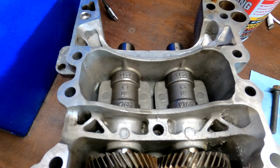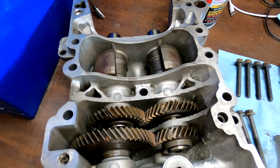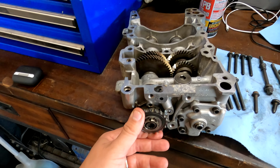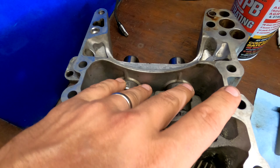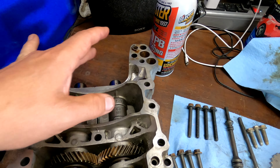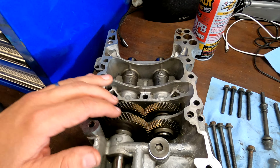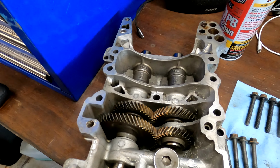Basically, there's two weights back there revolving. And when those weights go down, a piston goes up and vice versa. So it just offsets a bit of the vibration and makes the engine just a little bit smoother. I guess these wear out, and when they wear out, they have large clearances, and that can also be a reason for a loss of oil pressure, because too much oil is just flowing right through there. So some of the guys that run higher performance engines will actually delete these balance shafts. I think it lets the engine rev faster or rev higher, something like that. Less rotating mass.